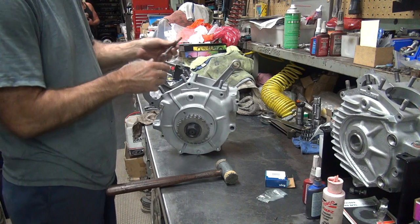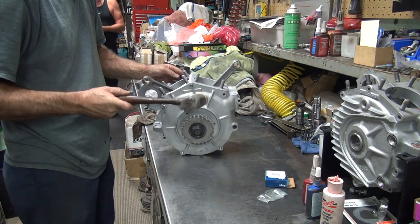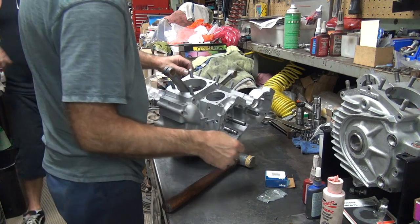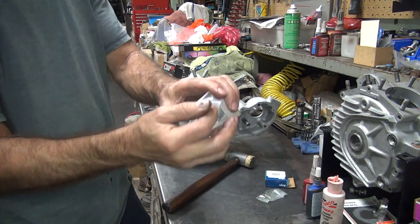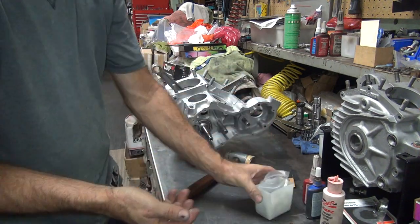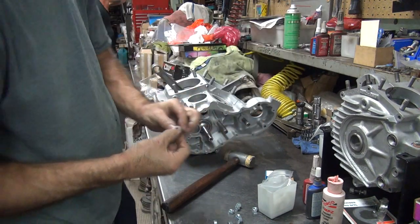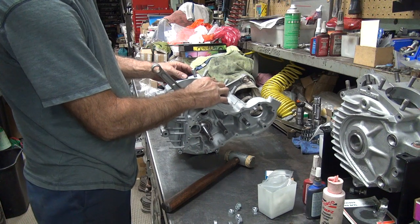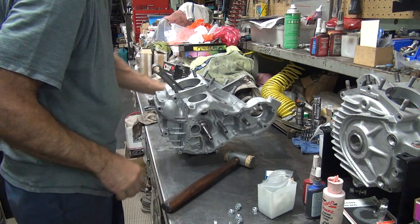Okay, the top center is the one you're missing, right? So my bolt's in the top center. Okay. Where's the nut go? Got brand new grade 5 nuts. We know they're grade 5 because they got writing on the side. That's how you know. If you don't have anything on the side of the nut, it's a grade 3 nut, which means it's not very strong. Which are all the ones you find everywhere else.